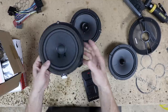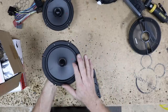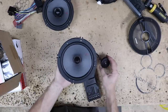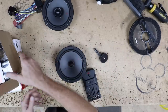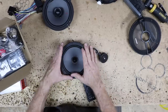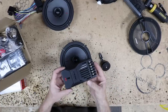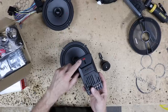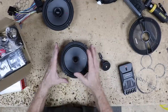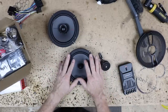The factory Ford speaker is plastic, typical — not a lot to the music, kind of boring and flat. The Kicker KS coaxials will definitely improve the rear sound. For the front, the KS components are the KSS 6504. It's like a one-stop shop: the box includes mounting brackets to convert it to a coaxial, so you could buy two sets and run them as coaxials in the rear or components up front. It also comes with a passive crossover network; attenuation is on top at 0, +4.5, or +9 dB of boost. The coaxial model number is the KSC 650s.